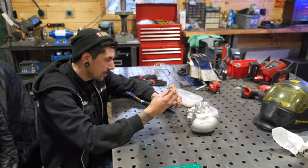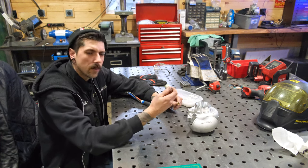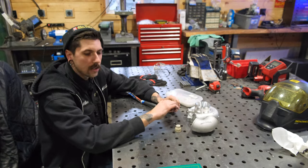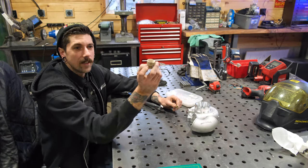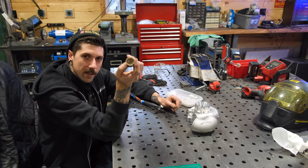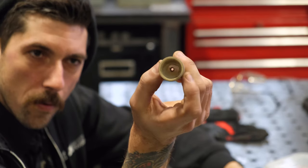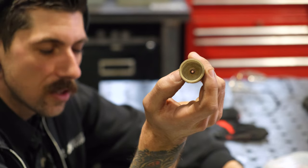As long as you don't abuse it, these cups, they're acrylic, Pyrex, whatever the hell they are. There's glass ones, and then there's these Pyrex, ceramic, whatever. Lots of options. Glass is more fragile than this at the end of the day. These have this nice little gas lens. Can you see that, Matt, on the screen? Can you see that gas lens that's in there? Hold on. Yep. So again, that's what gives you nice gas coverage.